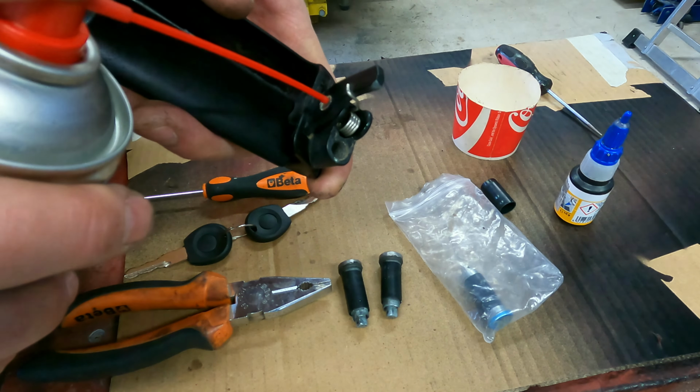I am going to take off these small pieces inside and take the new ones to put in the old one, because I see the key works fine here with the old one. It's the same profile, so the key slides in normally, and this is just fine, this is my old lock, but I want to have it with the same key, so I need to change those things one by one so I can put them in the correct order. So let's take off this one, and there are those small springs inside.